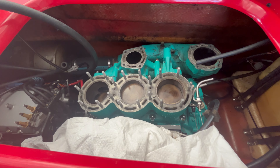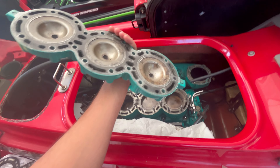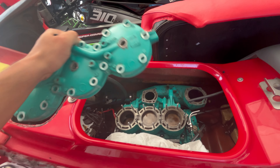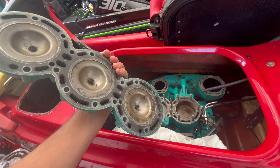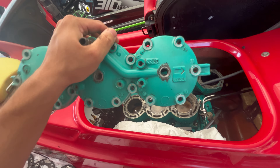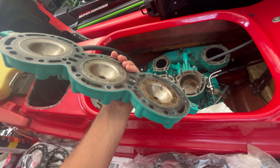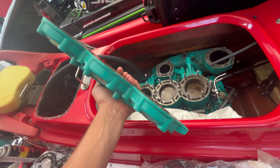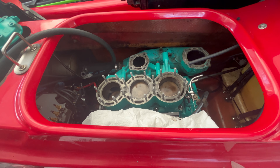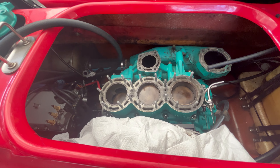The first thing I've done is removed any old gasket material that was present on both the cylinder head and on the block. This is not going to be decked or planed, but I've checked it — you want to make sure that it's not warped. This was within spec. You can lay it flat on a metal table and make sure it's completely flat. I cleaned all the surfaces with denatured alcohol.